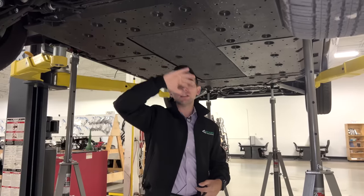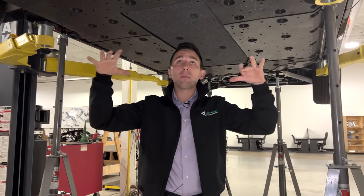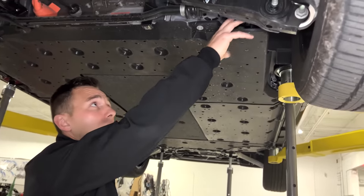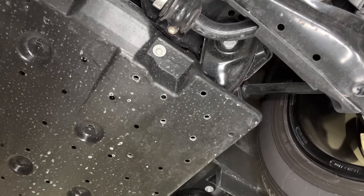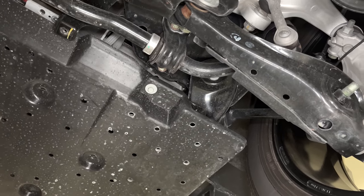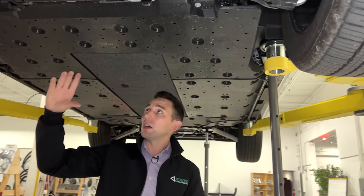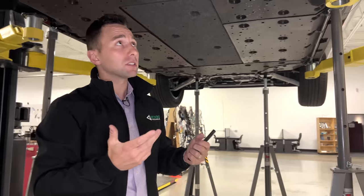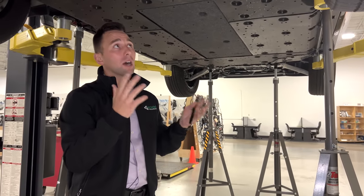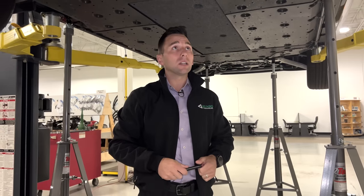But when that seat goes up, you often lose your structural continuity and perches for this battery pack to mount to. By leveraging the cradle with these double shear brackets, both the cradle and the battery pack might benefit. By tying those two things together structurally, you get a more monolithic approach. Those double shear brackets are going to stiffen that joint at the cradle, and they're also likely to provide some stiffness to the battery pack. It's an interesting decision. It's definitely not the first time we've seen it. A lot of OEMs, specifically in this crossover BEV space, Model Y size vehicles, are doing this, so it's not atypical, but it is one of the things that the Ariya chose to do.